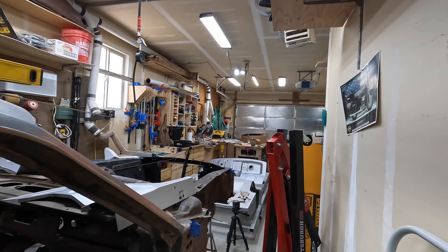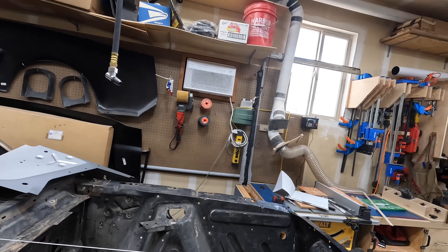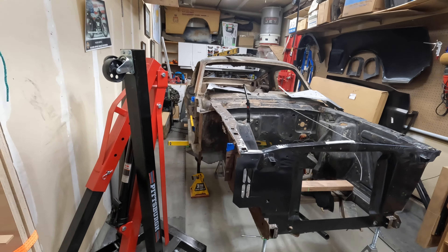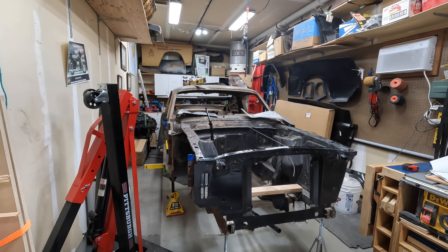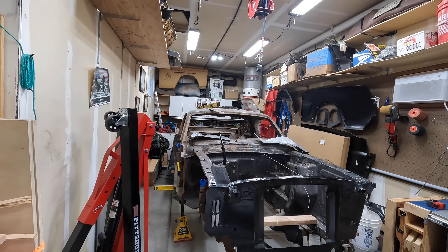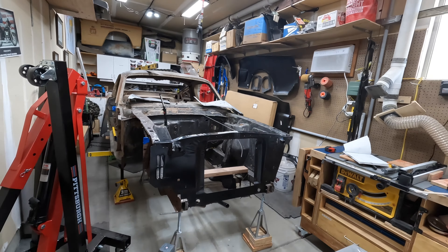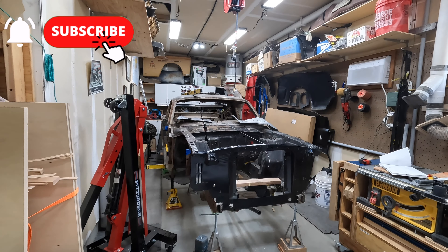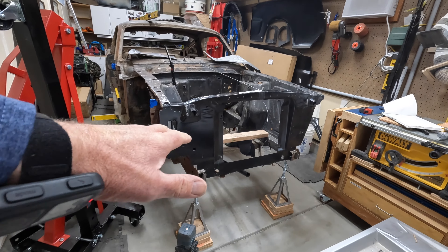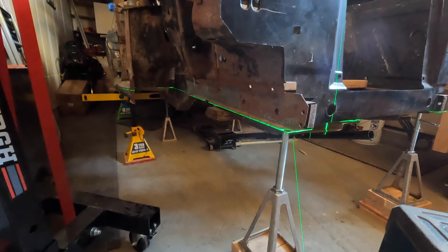So I just wanted to introduce you to the car — I haven't given it a name yet, I'm sure I'll come up with something unique. The first thing I want to do is introduce you to the car and then we'll start a full restoration of this thing. The first thing I'm going to be doing is getting it all leveled out, getting it on jack stands, and getting it prepped so that I can take some good dimensions and document that — so that when I start taking that firewall out and these apron pieces, when this thing naturally wants to sag and fall, I've got true dimensions that I can get it back to factory spec.